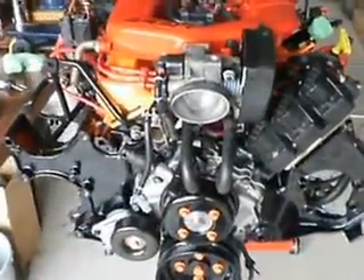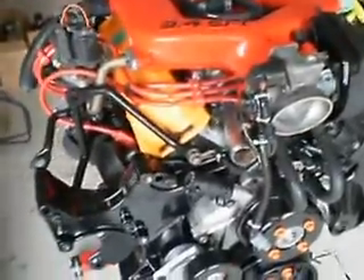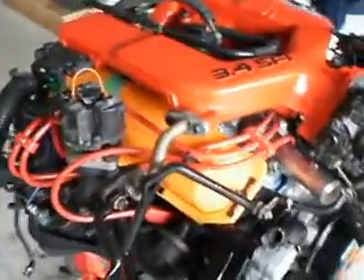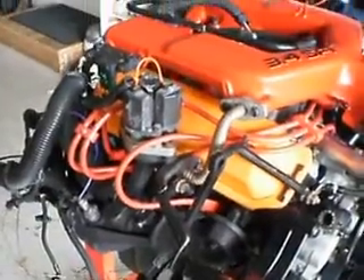Got a lot of parts powder coated — looks a lot nicer. We brought it to a race shop here in Windsor, Ontario, AP Racing. They honed out the cylinders, re-ringed it, new oil pump, new water pump, all the essentials like that. Basically just re-lifing the motor.